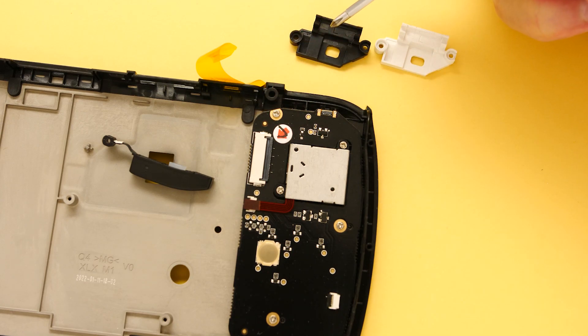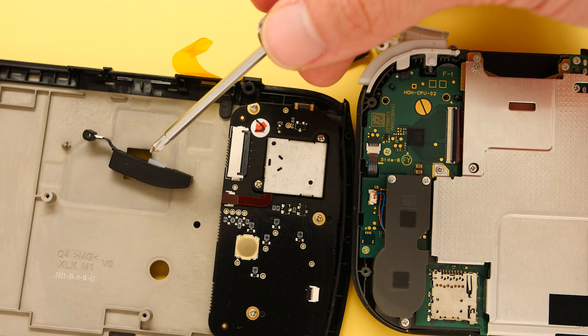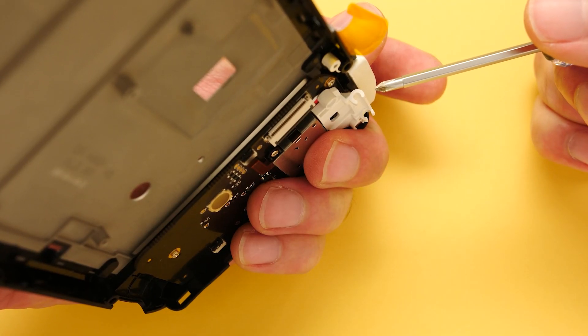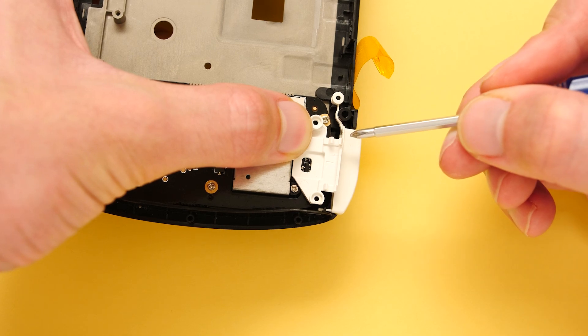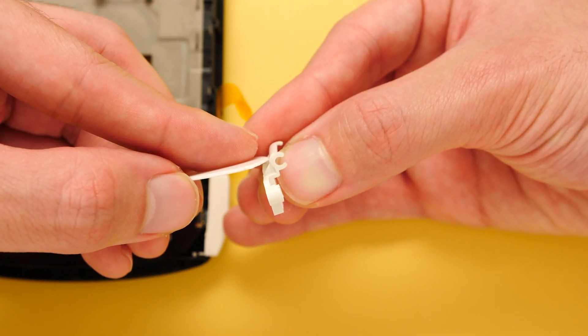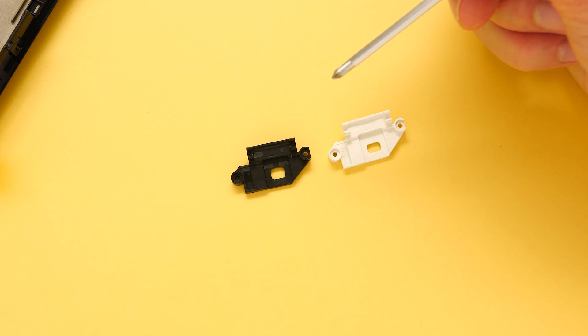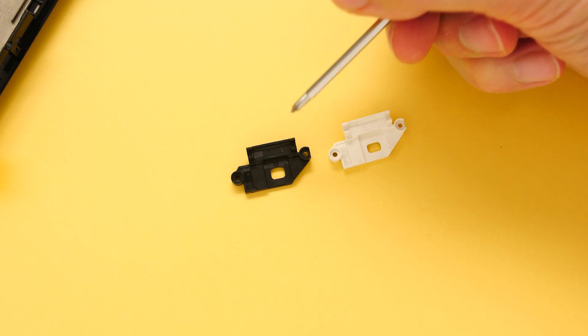Unlike the new button design, this change has no negative impact on the usability of the device. If your ultimate goal is to achieve something similar to what Nintendo has — a shelf that stops the button from going down further — and you've already failed at doing it on the button itself, your next best option, if you already have to modify this piece anyway, is to add the shelf to this. The part of this housing that clips onto L2 is at the perfect height to make a shelf to stop the L1 button from being able to break the Switch from the PCB. Essentially, you'd be creating a safety guardrail from this back piece to stop the L1 button from being able to go down further than it should. For those that need the repair kit, they would only need to replace this piece and the controller board itself if the Switch was broken. For future manufacturing, they would only need to modify this one piece.